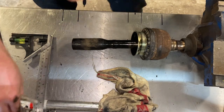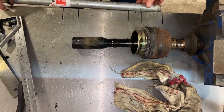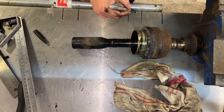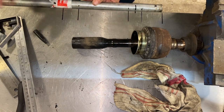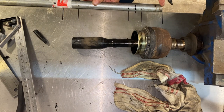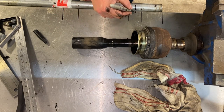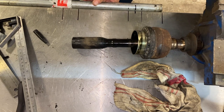So when I take my reference point — let's say this end of the shaft that I'm making needs to sit there because that's where the CV cup goes — then when I'm machining the shafts, the circlip groove needs to be here because it's in the internal throat of the shaft. Then I need to do the same on the opposite side. That basically gives me a measurement from outside to their circlip to the halfway mark. I can do the same on the other one and then work out what length this shaft should be.